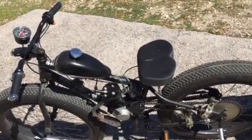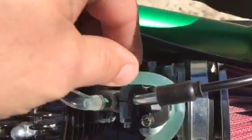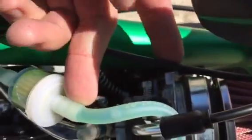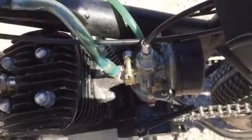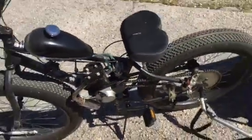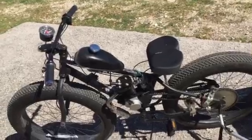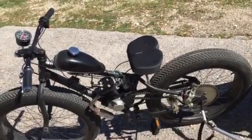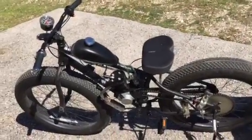You also have to follow a different procedure in starting it. With the racing carburetor, all you do to choke it is simply pull this lever up right here, then push it forward and it pumps back up after it kicks off and starts. On the original model, you have to come over here and pump this little button to pump fuel in, and then here's the choke that you just lower when you get it started. But they both work. The racing carburetor is just better, especially if you're at different elevations — this one comes standard with a size 70 main jet. You'd probably get better performance at higher or lower elevation with the racing carburetor because you can customize it. These are not customizable.